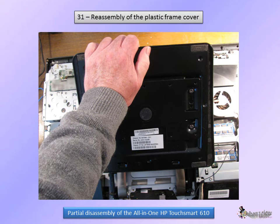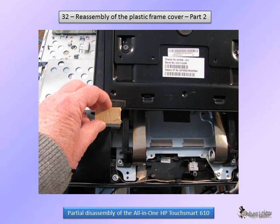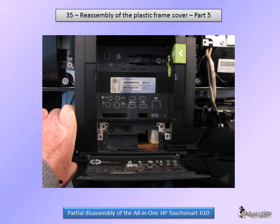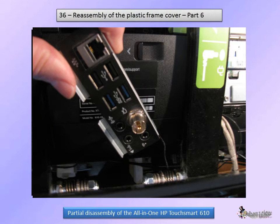Now you need to prepare the reassembly of the frame cover. Begin by sliding the base into the up position, then prevent it from coming back to its resting position. You may now insert the bottom of the frame cover under the base. Let's slide the base back to its original position. Open the I.O. cover. The first screws you have to put back are these two ones here. Now insert the I.O. block from under the base, between the hinges, and temporarily leave it on the right of the cover.